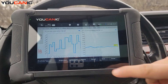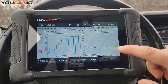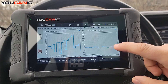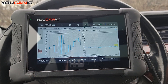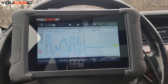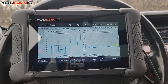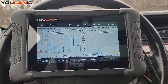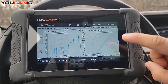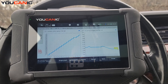If the catalytic converter is NOT doing its job, you'll see the downstream oxygen sensor graph fluctuating up and down, resembling the upstream graph. That means the catalytic converter isn't treating the exhaust gases at all — whatever you see upstream, you see downstream — and that is not good. So this left catalytic converter is healthy; now let's look at the right one.